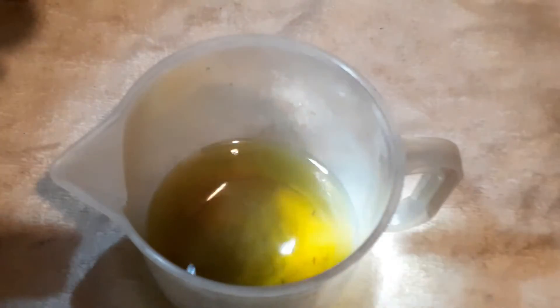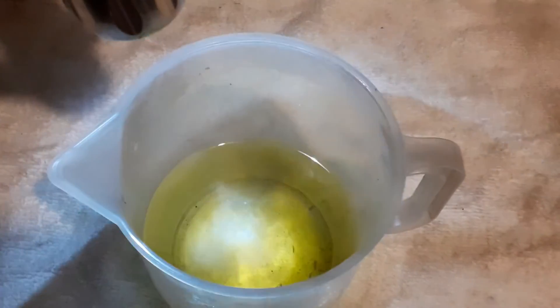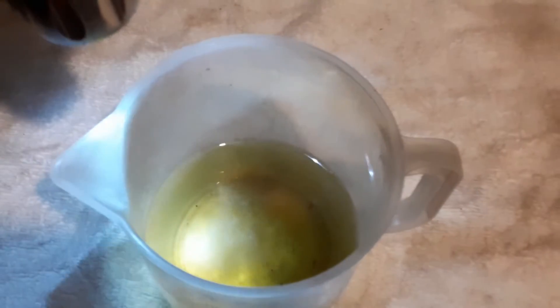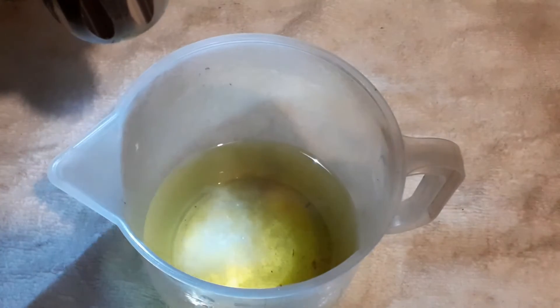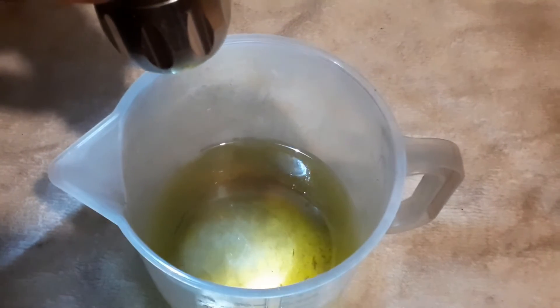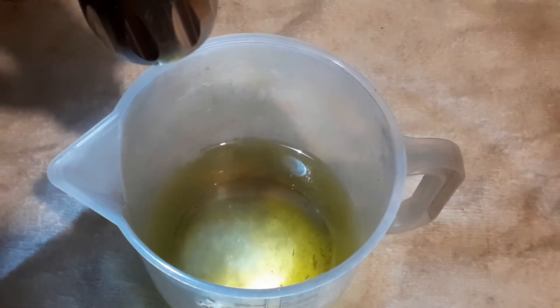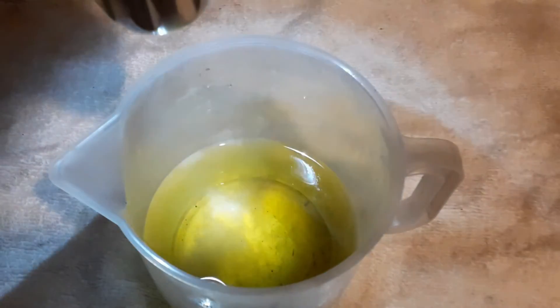You can actually see better from above. This strange wispy material took me a while to figure out. You often get something called diesel bug in diesel, which is basically a bacterial growth, but I've never seen anything like this in petrol. When I looked closely at this wispy material, what I found was lots of small organic particles — basically bits of wood, rubbish, and soil — suspended in it. Because they are lighter than water, they're floating to the top of the water. I think that's just bits of rubbish in a wispy water suspension. Never seen anything like that before.